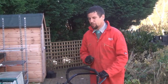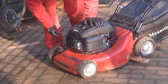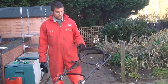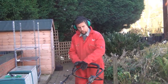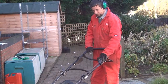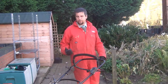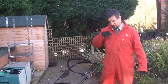We're now going to go through and start this machine. First we put the HT lead back on the spark plug — it fits in there OK. As we haven't started this machine today, we need to engage fully into the choke position. Because the college policy is to wear ear defenders with all machinery, we'll put those on first. We'll then hold this handle down and give it a start. OK, so we started the machine in the choke position — it fired first time, and then I just dropped the revs down and released the handle to stop it. So we know the machine starts and we're happy with that.